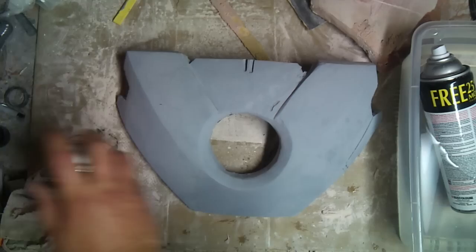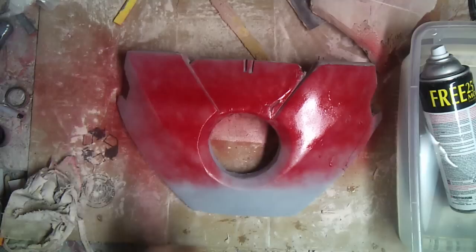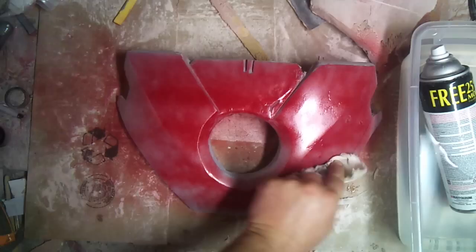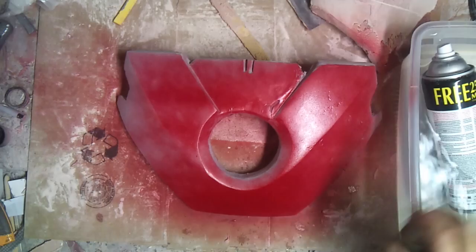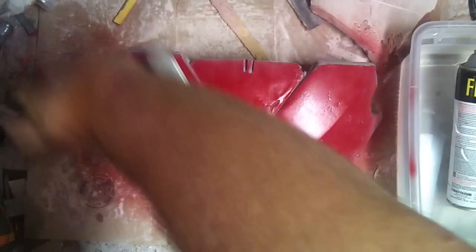This is about hand temperature, so you want to spray straight across. I got a little bit of water on here — this is a first coat so it really doesn't matter — but you want your paint surface as dry as possible, and in cold temperatures you want it as warm as possible. I'm just going to shoot a couple of quick coats on here.